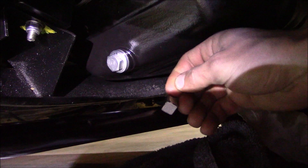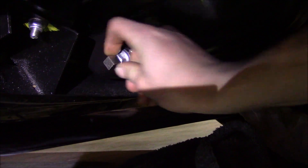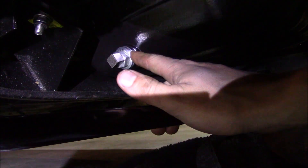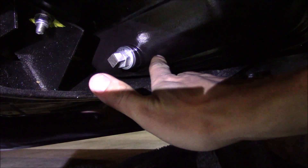This isn't my motorsport tech tip or anything, but one thing I forgot to do earlier is add a neodymium magnet to my drain plug so the filings will collect on the end of that. You can also put one on the inside, but this one's too long, and you've got to be careful that you don't bottom out against the oil pump pickup because it's right through there.